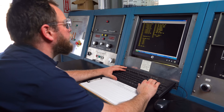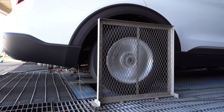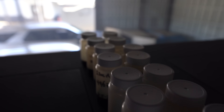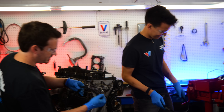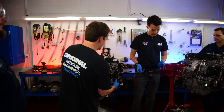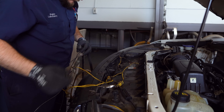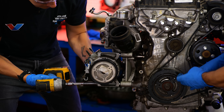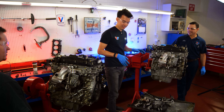I've kind of been with the project since we purchased the Explorers new in 2020. We went with a cycle based off a standard cycle, modified slightly — not just flat-out cruising, but going down to idle and ramping up, like stop-and-go as a normal person would experience. When we first started, we ran everything exactly how Ford specified: 10,000-mile oil drains, sampling every thousand miles. See the wear from the synthetic oil on the belt — much better. You can see way less varnishing. These were drive-by-wire, so we put in voltage isolators and set it directly to the throttle pedal — just computer controlled, no drivers. I just can't believe this has 500,000 miles on it.